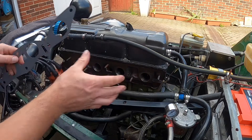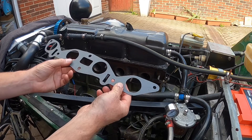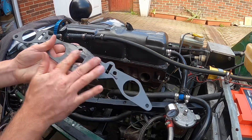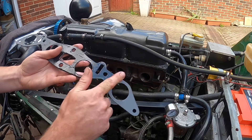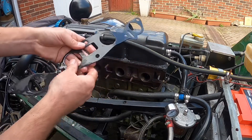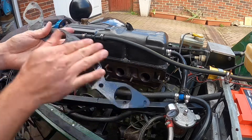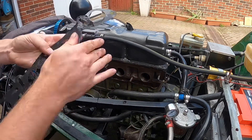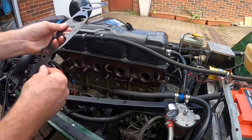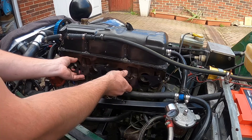I've got a nice new gasket to go in here. You'll notice that the old gasket got destroyed when I took it off — I didn't put it on dry, I actually put on some gasket sealant. But this time I'm going to apply a thin layer of oil on there instead. I'm using Valvoline VR1 20W50 — nice thick oil that this engine runs well on. Covering both sides; that will seal any air that's wanting to get in where it gets sucked in, rather than putting a completely dry gasket on. So it's just a case of sliding that gasket onto the location.